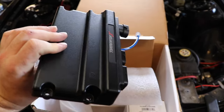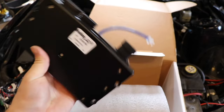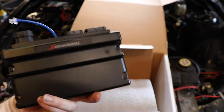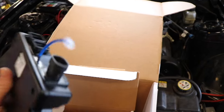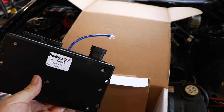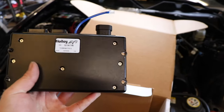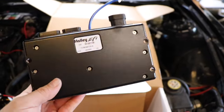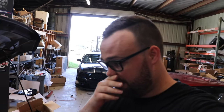We are not doing transmission control. My single turbo coyote car has Terminator X Max that could handle drive-by-wire and VCT, but we didn't end up using that. This one is a little bit simpler, a little bit cheaper. There is a vacuum line there for naturally aspirated applications, but we have a 3.5 bar MAP sensor from Holley, and some fuel pressure and oil pressure sensors that will hook into the harness.